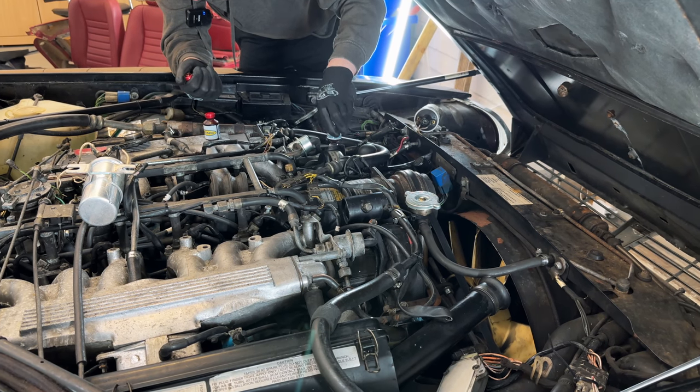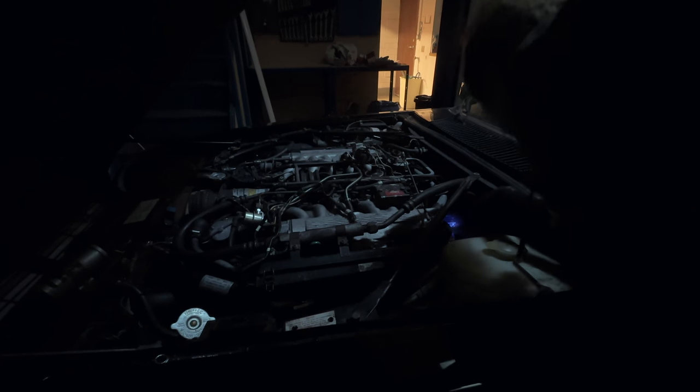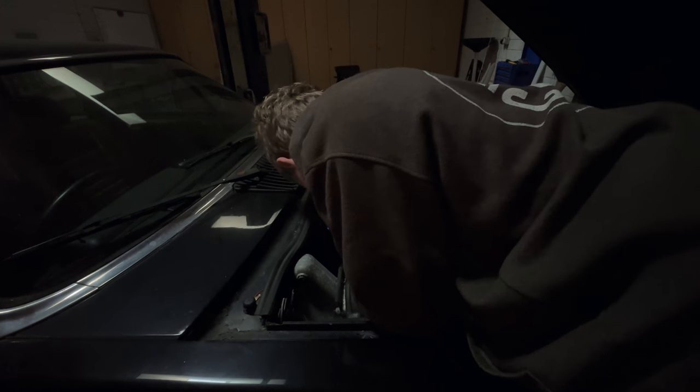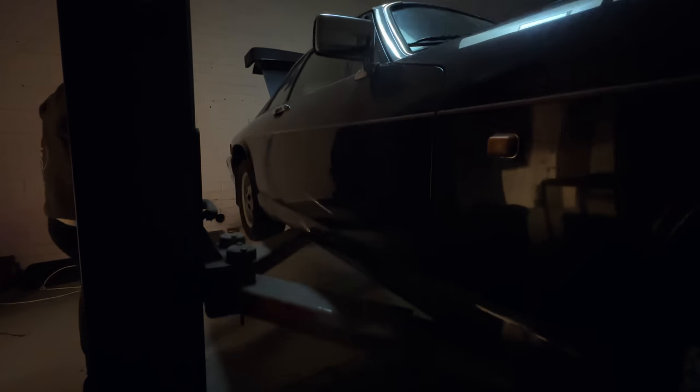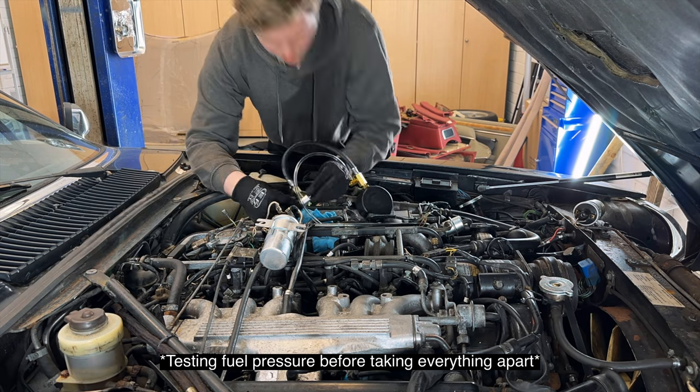Put it into your oil and then run the engine for about 20 minutes. It doesn't look too shabby. There is a little bit right down the back here which I assume is the half moon. It's really hard to see but there's a banjo bolt that's glowing green, so that is obviously a leak up there.